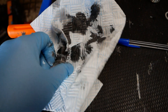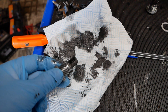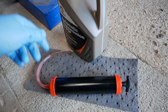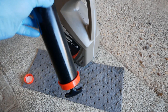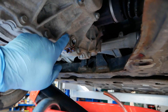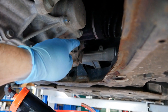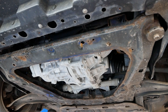What you need to do now is properly wipe all the rubbish off these magnets so they're nice and clean — you can just do that with a tissue. Wipe both clean and get all those iron filings off. Then put the drain plug back in first, and fill it up from the fill plug. Suck the oil up into your syringe — you'll need to do this many times — then push the oil in through the fill plug hole. Fill until the oil starts dribbling out of the fill plug, then put the cap back in. Finally, put your under tray back on and put the vehicle back on the ground — very simple job.